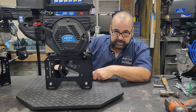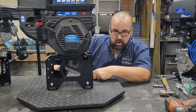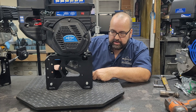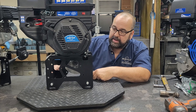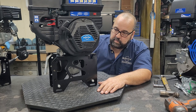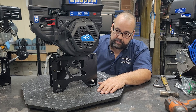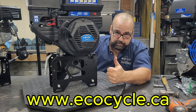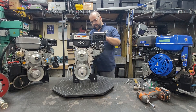If you don't want to invest in the gearbox yet and you have a CVT backing plate — which is under a hundred dollars — and engines are still dirt cheap, order your power pack bracket kit today. The difference between the light and the deluxe is the deluxe offers a jackshaft and a battery mounting provision for electric start. Both mount a 196 to 224cc GX-style clone motor. Go to www.ecocycle.ca — I've got them in stock and I'm happy to ship one out.